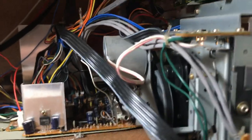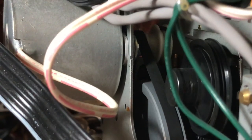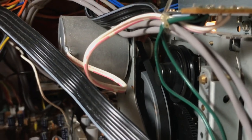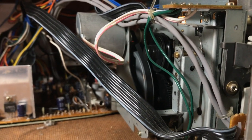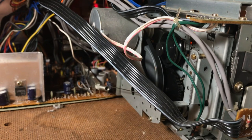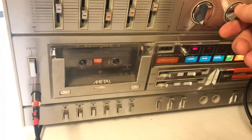When it was first played it may have kicked the belt off. If you can see up in there, it sits on that little drive spindle — I'm trying to zoom in up in there — and that's what turns the flywheel. It just came off. So I worked it back on, spun it around, got it going again, and to my surprise the belt was in really good condition, still very flexible, and it still worked.